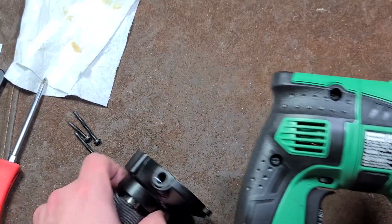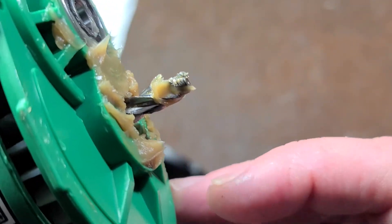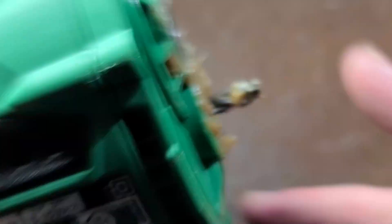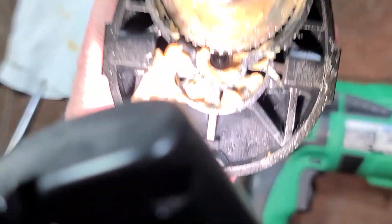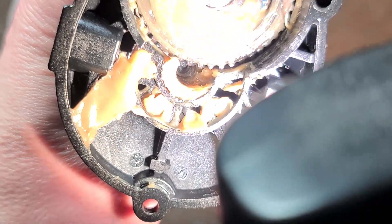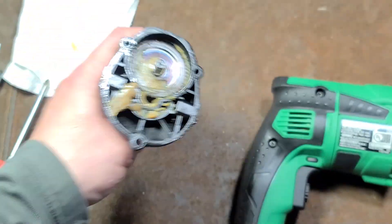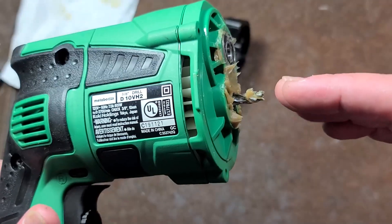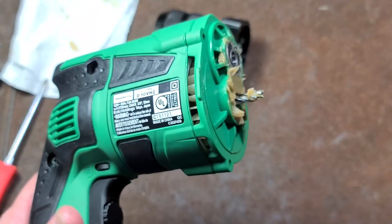They're taking something out of DeWalt Black & Decker's playbook — DeWalt Black & Decker have been doing this for a very long time on their drills. You can see it's kind of odd, but they've machined down the tip of the gear — it's actually to help support it and keep it from deflecting. If we get in there, there's a tiny little sleeve bearing right there, providing additional support for the tip of the spindle. So under heavy-duty loads, it isn't deflecting and causing uneven wear. That actually is a nice touch.